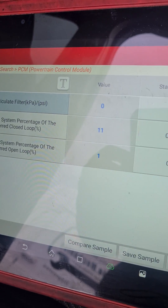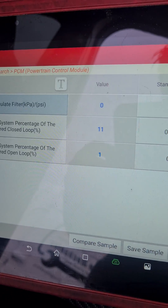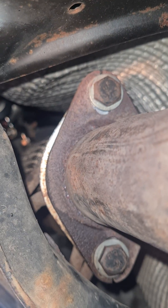He's here having me look at it. The main problem is that when the vehicle is idling, we're not seeing any pressure. And that is the vehicle idling there. Looking under the car, we can see it's had new bolts and gaskets because they've taken the DPF off.